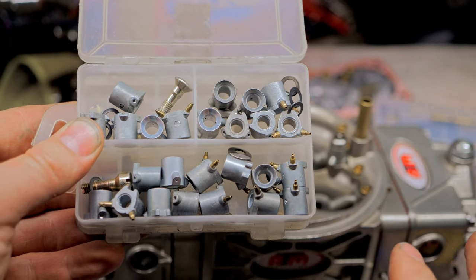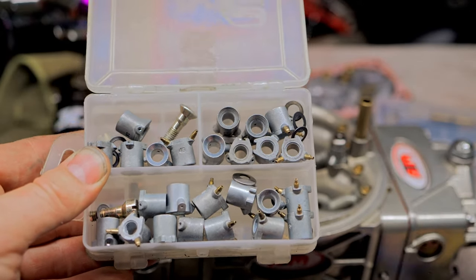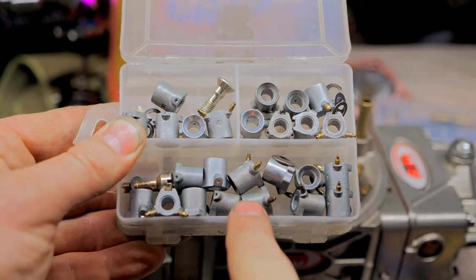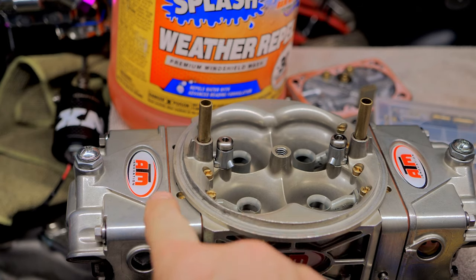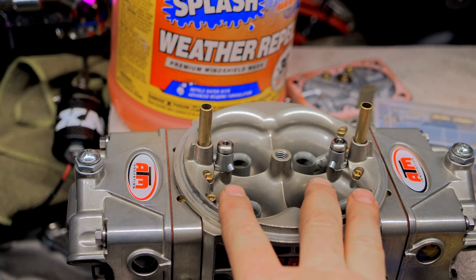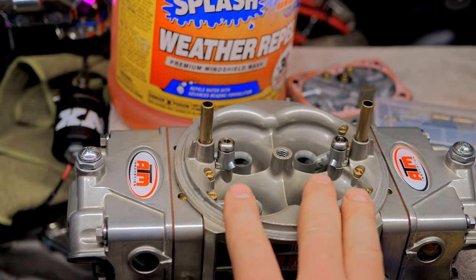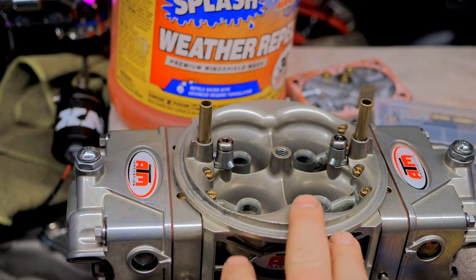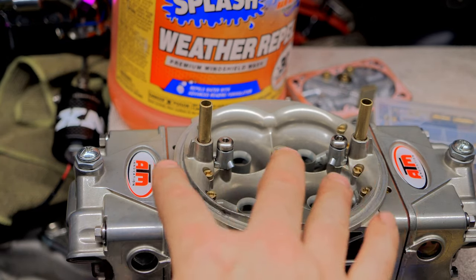If you have anything in your carburetor, or every time you stab at the gas, and it gets too fat, right, when you stab at it really hard, it's all discharge nozzles, cams, accelerator pumps. This is the most tricky thing. These guys, this transition right here, in my experience, is the most tricky thing to set up, and it's also crucial. Because a lot of times, people get those stumbles and all the other crap, and they'll mess with their jets, or they'll mess with, like, their idle air. No, don't do it. This is how you get to the next part, this transition right here.